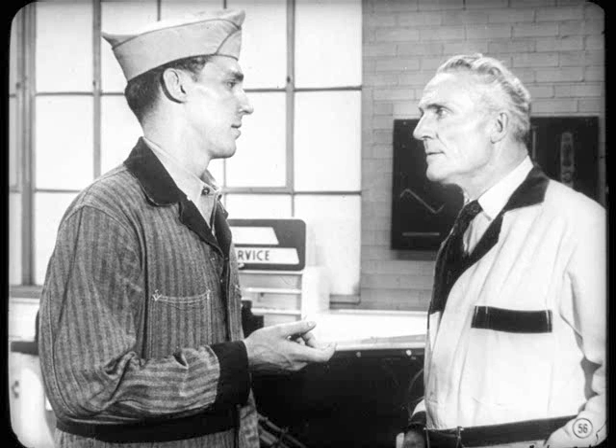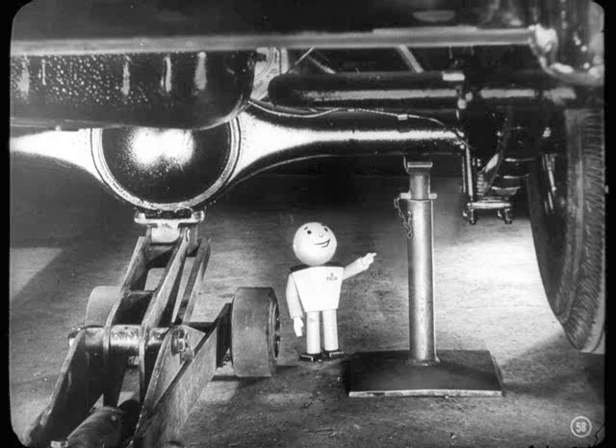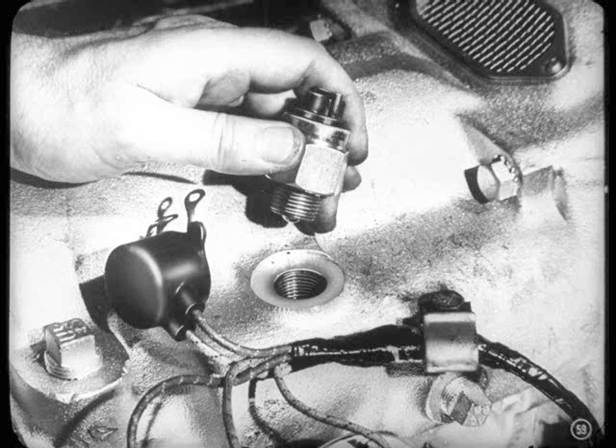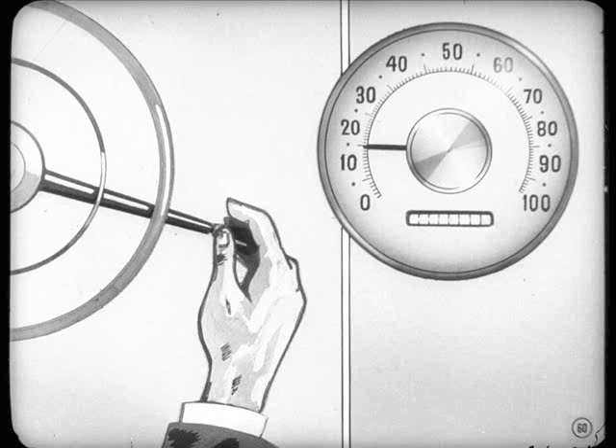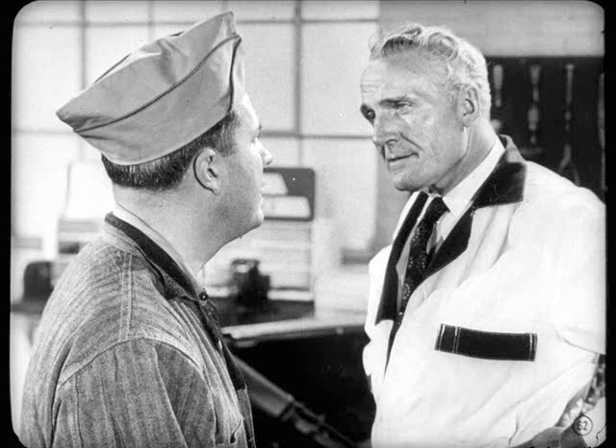What would you check next if your electrical test showed everything was okay but the transmission still wouldn't upshift? Upshift troubles could be caused by faulty operation of the hydraulic system, so I'd check that next. I'd jack up the rear end so the rear wheels were clear of the floor — use jack stands under the rear axle; it's safer that way. Next, I'd take out the interrupter switch so I could watch the movement of the direct speed piston. Then I'd start the engine, shift to the driving range, and accelerate until the speedometer reads above 13 miles per hour. At the upshift speed, the piston should move ahead and block the switch hole, showing that the hydraulic system is working okay. But if the piston doesn't move, there's something wrong in the hydraulic system.